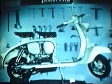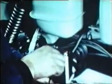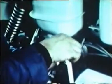Replace the horn casting, mud guard and lastly the headlamp. To check the battery acid level, unscrew the two nuts fixing the battery support to the frame brackets. Add distilled water until the liquid level is about a quarter of an inch higher than the battery cell separators. This operation should be repeated at least once a month, while in hot weather about every two weeks.